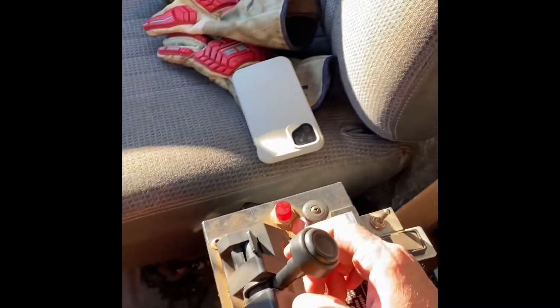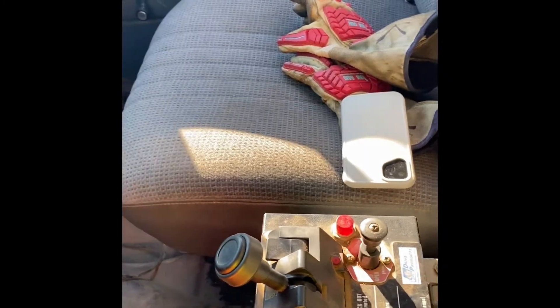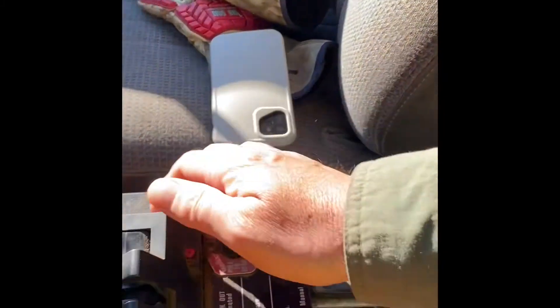You can see the material being dumped out. What I do is pull it forward a little — it locks as soon as you hit the top of the piston. You don't want to put excess pressure on the top of the piston. Put the truck in first gear and pull away a little, until you hear the tailgate drop, then drop the box. Pull it forward — you can see the box going down — all the way down, then lock your tailgate.